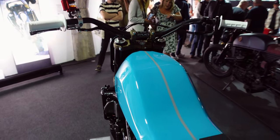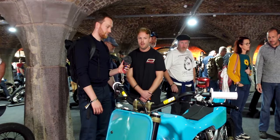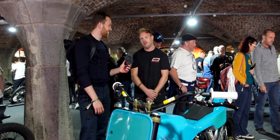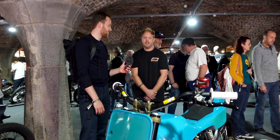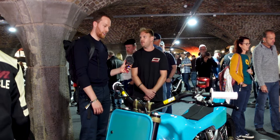So you have everything electronic in the front? Yes. I built a hanger bracket at the front so we have the battery and ECU in there. It retains all of the original electronics that I've modified, so we still have the relays and all of the original parts needed to run the bike on the road as well. So it is a road bike.